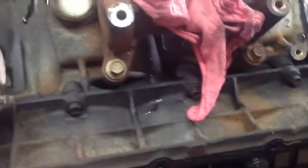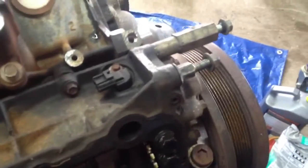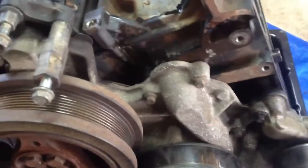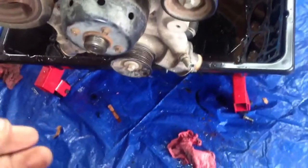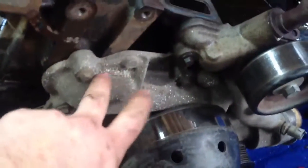If you've got to replace your bed plate gasket, that's how you'd do it. Mine's not leaking, it looks good — I'm not going to touch it. What I do have to do is take this front cover off so I can take it down. I'm going to have this dipped and soaked for a while, replace the gasket as well. I'm just trying to fight the corrosion here — on the east coast you get all the salt that starts corroding the aluminum.